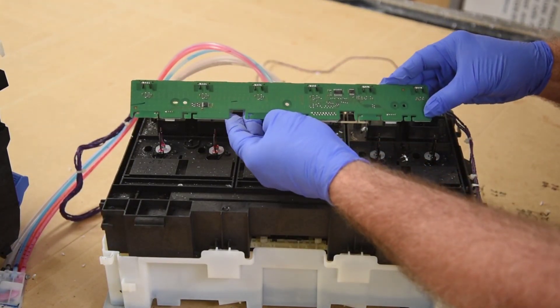I think the cam can be pushed a bit and then get popped out - yes, there we go. Much better. There are only two screws left holding in this ink tank section - I'm going to go ahead and remove them. The ink tube channels are right down here under this foil, so I'm quite sure ink is going to pour out when I loosen these last two screws. Didn't get that recorded, but I can assure you I did make a mess - at least it was a controlled mess. So here is the matte black and photo black tanks. Looks like a plate with two screws holding the pump section. Let me get the cam arm off and see. A little broken plastic isn't going to hurt anything at this point. So there is a third screw hiding under the cam arm. The pump plate just lifts right off after getting all three screws out.